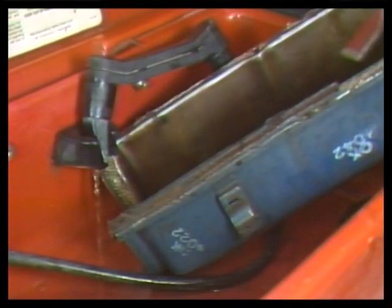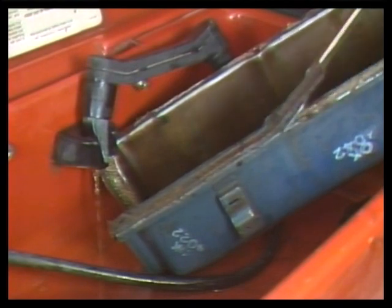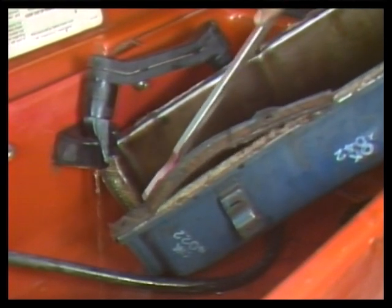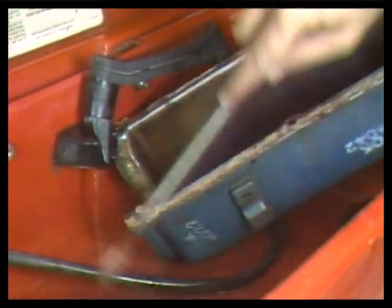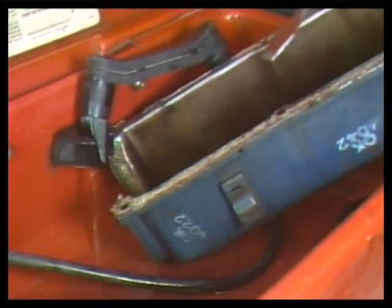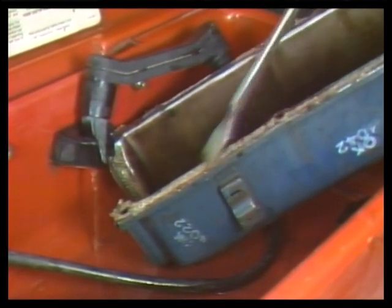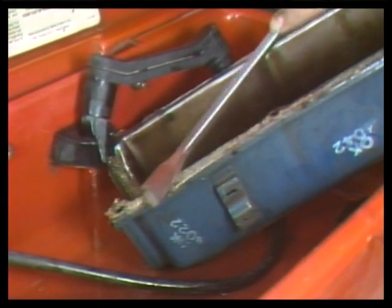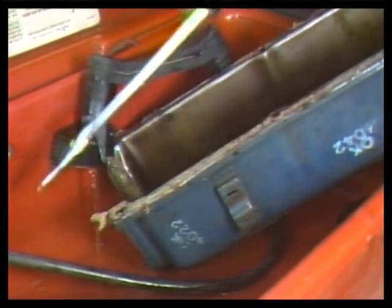Always clean all engine parts thoroughly. Scrape all old gasket material and wash off dirty oil in a cold solvent tank. Remember, if you leave even one bit of old gasket material, it can lead to serious oil or coolant leaks. In auto mechanics, cleanliness cannot be overstressed.